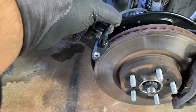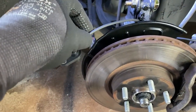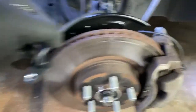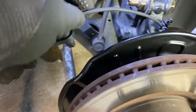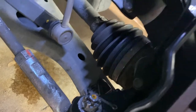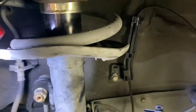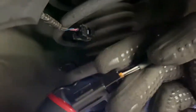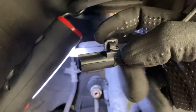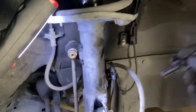Just like I thought, it doesn't come with the bolt. So I'm glad I saved the old one down there because the new one does not come with the bolt. We're going to go ahead and put this in first. Make sure this is all snug because I don't want this waving around while I'm trying to hook up everything over there. So let's go ahead and put this in its place. I got everything in — got the actual sensor in. I didn't tighten this one all the way down, then tightened this one all the way down, tightened this one down to give me some slack. And then all I got to do is just connect these two right here. And you want to make sure that whenever you connect these two, you put this clip back in so it stays nice and safe.